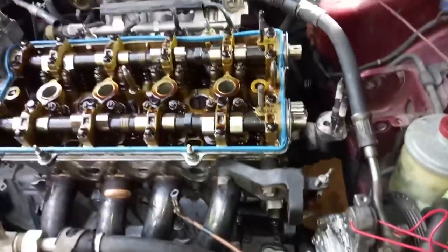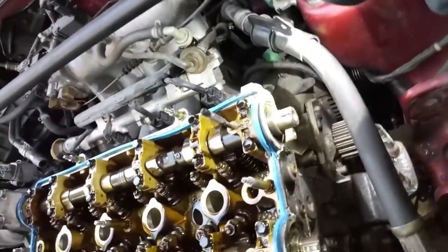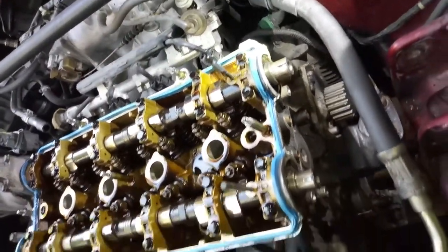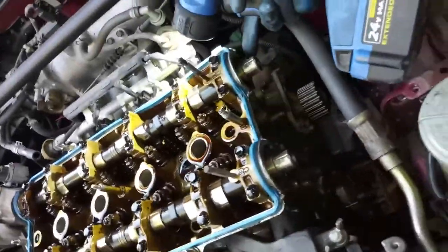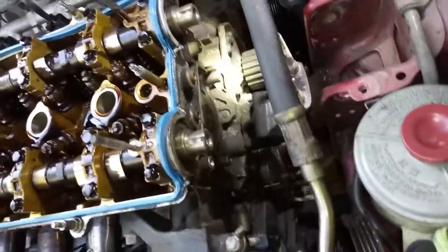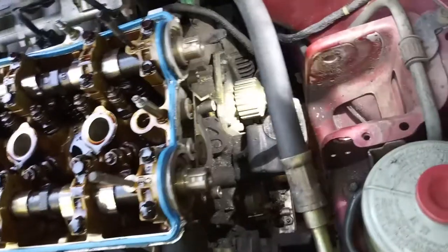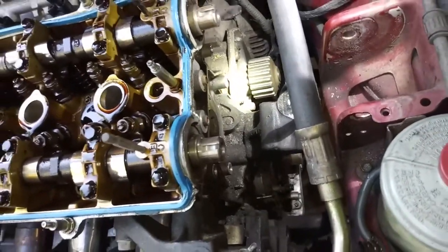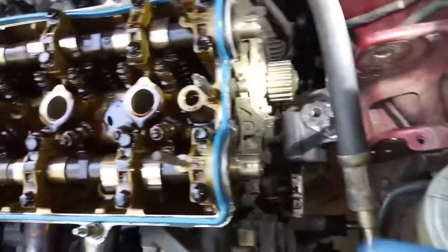There's like wet oil right there. It doesn't seem like it's fast. All this would be wet right here too. In that case, all this would be wet underneath there. It's covered all the way down. Should be oiled up. So it's making me believe that, because you see that sludge on top of the pump down there. I'm thinking that's the pump probably leaking behind it. Yeah. There's no signs of it actually dripping all the way through.